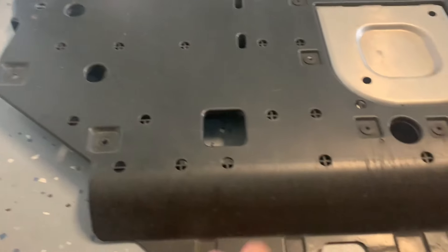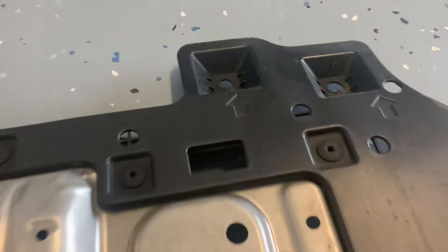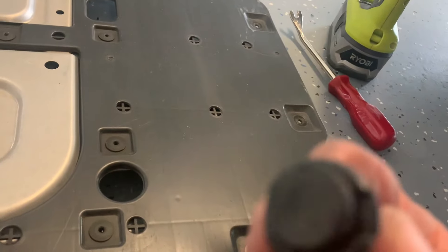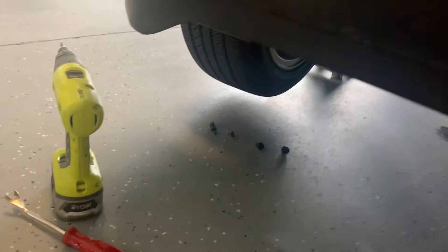There are six little screws on the splash shield to take out. The splash shield is removed — there are five plastic clips: one up here and four in the back. The original clips were a square with a plastic Phillips screw, but those are long since broken and I've replaced them with regular clips I buy in bulk from Napa or Amazon. Once the splash shield is out of the way you can get to the drain bolt.